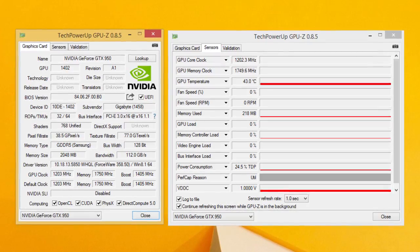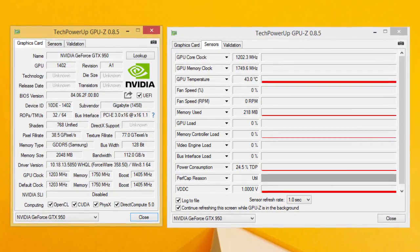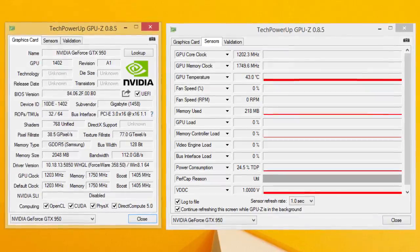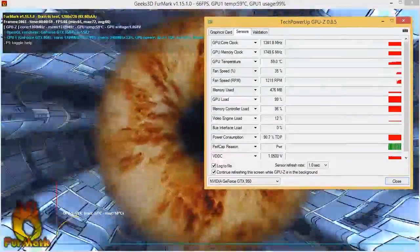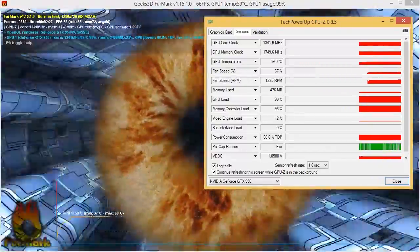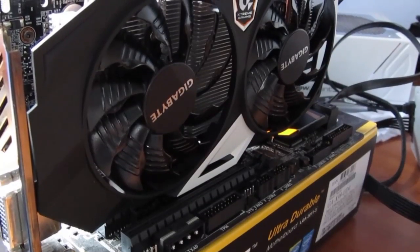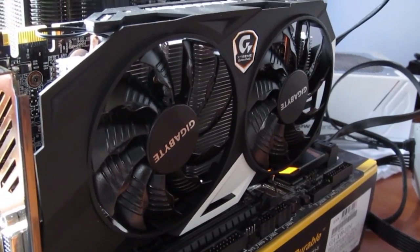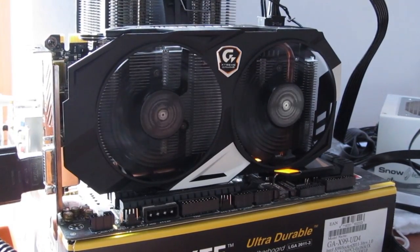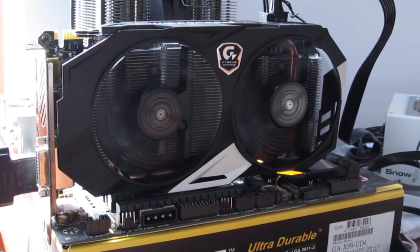Looking at the temperatures, in idle we have a bit higher number, as the card's fans are off if the GPU is below 55 degrees Celsius. After that the card turns on the fans, and it doesn't cross over the 60 degrees Celsius mark, but stays just below it. Some games don't even turn on the fans, and generally, since the temperature difference between fans being on or off is really small, the card is constantly running in between those two states of passive and active cooling, ramping down and up the fans, which can be a little bit annoying, especially on an open test bench. On the other hand, at least they are very quiet when working.